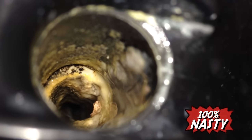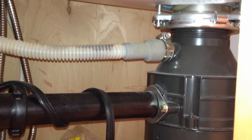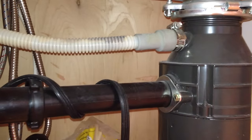Before you take apart your dishwasher, you're going to want to look inside your garbage disposal and see if the pipe is clogged. There's a little hole inside — it's kind of nasty — or you can unscrew the pipe that's attached to it under your sink. That pipe leads to your dishwasher. If that's clogged with food or clogged with something, then the water's not going to be able to leave your dishwasher — it's going to sit in there, or it could just be restricted. So make sure that pipe's clean.